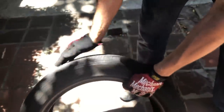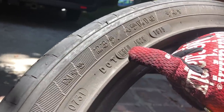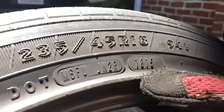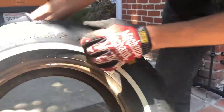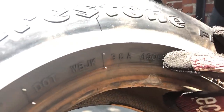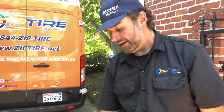How old are your tires? On one side of every tire, it's mandated by the Department of Transport to put a stamp. The first part is the manufacturing code of the plant. The last four digits tell you when the tire was built — for example, 1815 means the 18th week of 2015. So if you're buying a used car or used tires, take a second to check, because all four tires may be different. If you have anything other than the four-digit format, your tire is already too old.